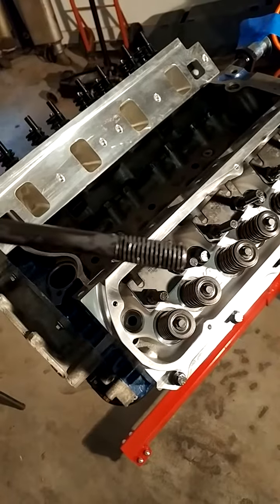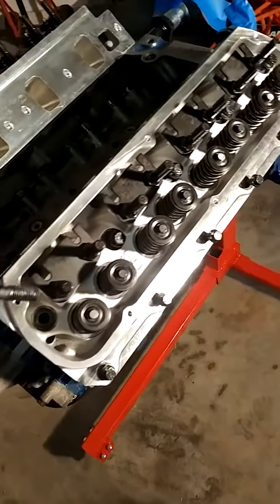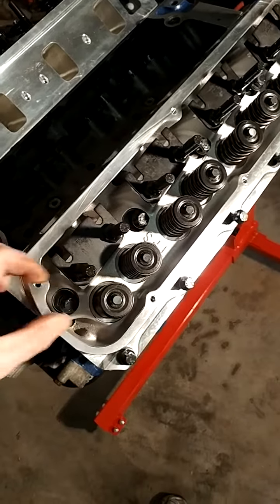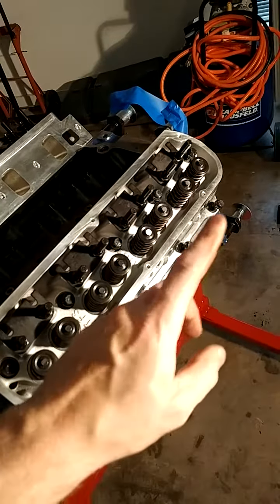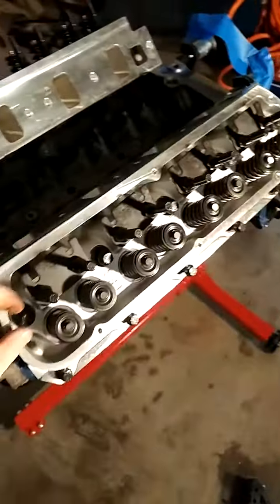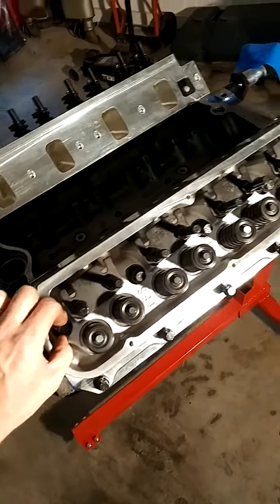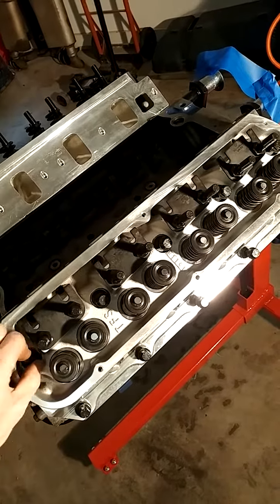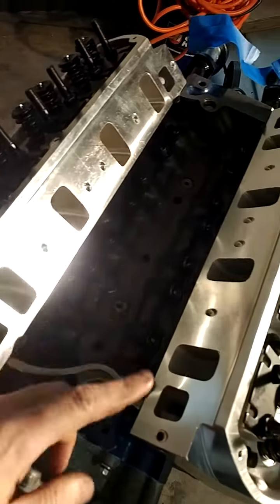I got a little ARP anti-seize grease, the torque for the torque spec, and slide that in there, and I want to be able to finger tighten that. So I did that for all 5 here, 10, 15, and 20 over here. And then again, I can finger tighten it in there. There's no dirt, there's no debris, and it's going to give me no problems. And then in the next video, I've got everything set up.